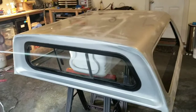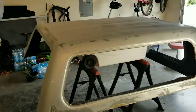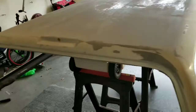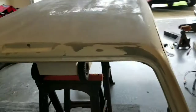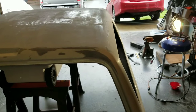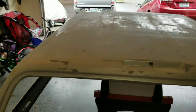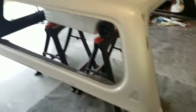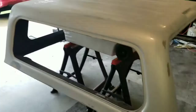I'm going to sand down to 400 grit right now. Some people say with metallic paints it's safer to go 600 so the sandpaper scratches don't show. I've basically touched up all the spots where there were big gouges, got the top layer off where it looked really bad, and I'm going to just do it with the glazing putty. I've gone over everything to dull the surface for when it comes time to paint.